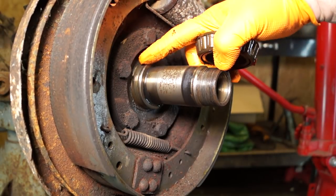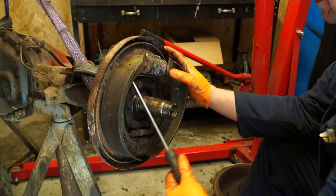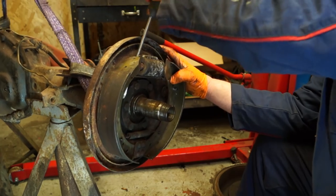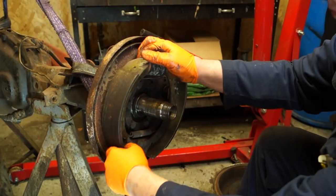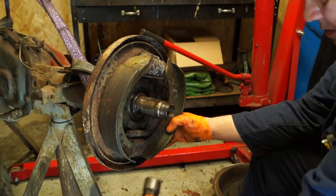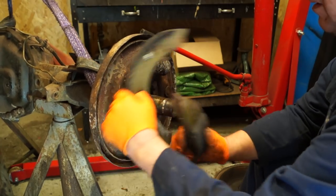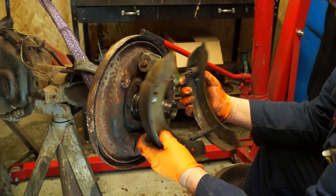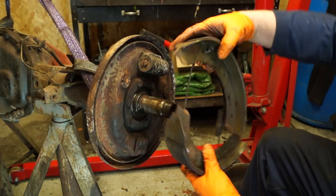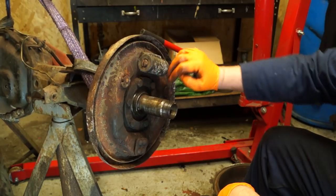This stub axle actually had the front bearing rusted in — that was quite awkward to get off. You can wiggle the hub off with the wheel on. So the next thing to do is to remove the shoes — a screwdriver and everything should come undone. At the bottom here they do get corroded into place, a little tap with a hammer and that's out. That's the shoes stripped off. Remember which way the springs go round. In this case the brake shoes were set wrong — just be aware of that.